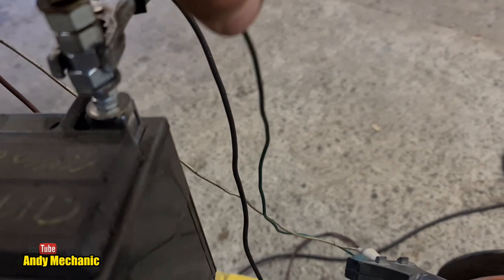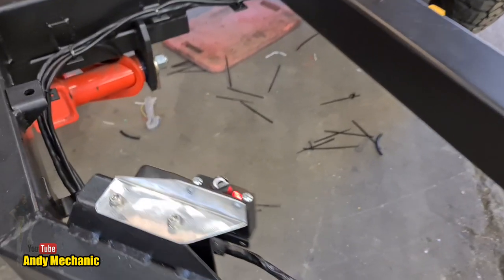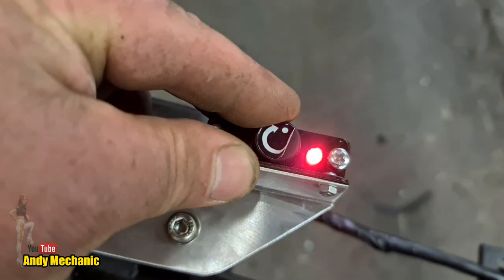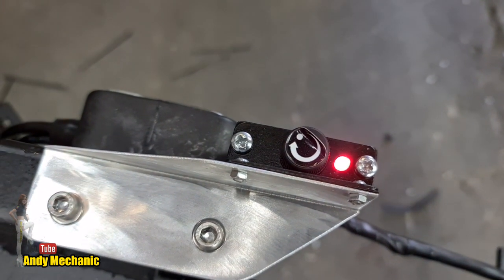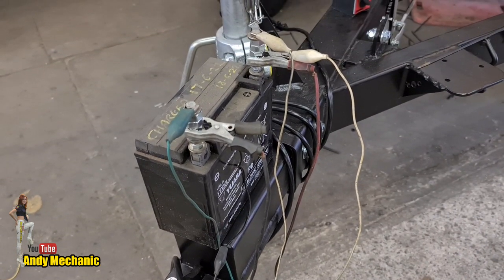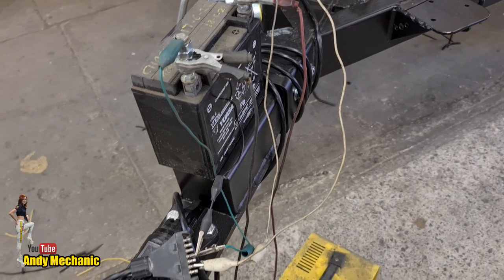I think that's because I'm using some really small jumper leads, which carry very little amps to power it. So if I power it directly, we should be good. But I'll check it on the little Jimny before we leave. If I turn it down, it seems to work fine. Yes, interesting. I was right! Look at this! So, yes, my little jumper wires are not really meant for this kind of thing. They're more just for lights, as opposed to, obviously, these brakes, which use a lot more current. So I've just doubled up the jumper leads, twice the carrying capacity.